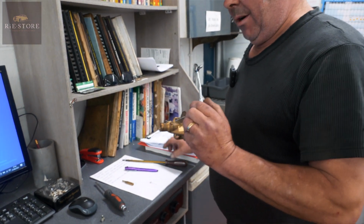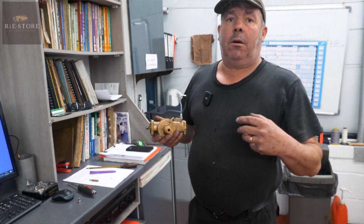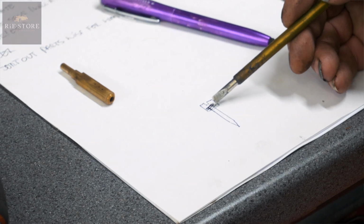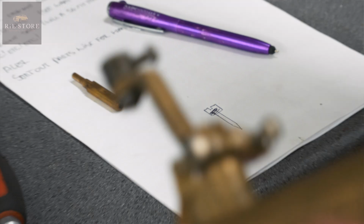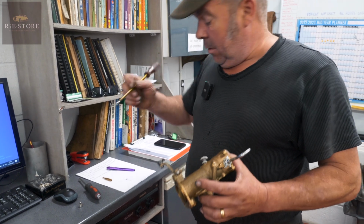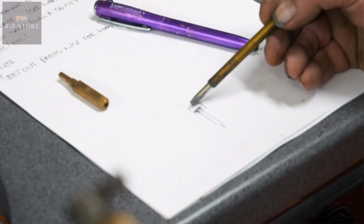So what you've got to do, and invariably the reproduction needles you get are terrible. They really are, because that's mild steel, that's brass, the threaded piece. Now that doesn't get pressed hard enough onto the needle. And what a lot of people do is wind them up, and it pushes, which is what's happened to this, it pushes that down. Needle comes up through the hole in the middle. You can't get the screwdriver in the slot because the needle's come up through it.